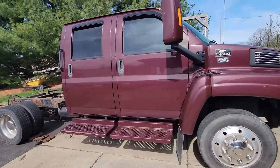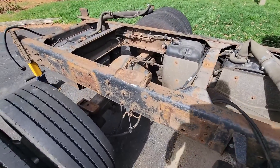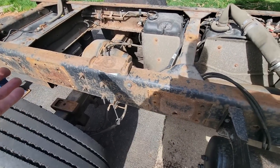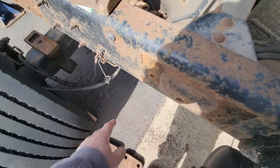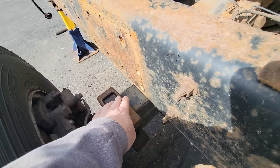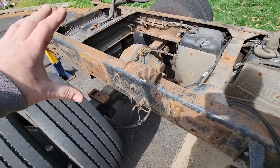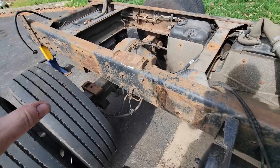This is part two of the C4500 build. There were questions in the last video about the suspension and why I want to replace it when most people thought it was okay. In most cases it probably is, but I'll talk about what we're looking for and why. The brackets came down and that beam was real tall, leaving us with just a little bit of travel before we hit the bump stops - we don't want that. A taller bag means more travel and a better adjustable ride.